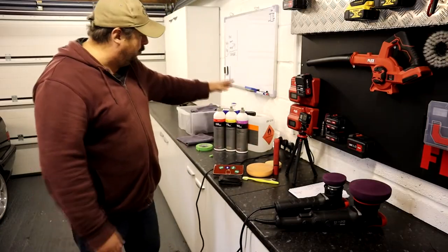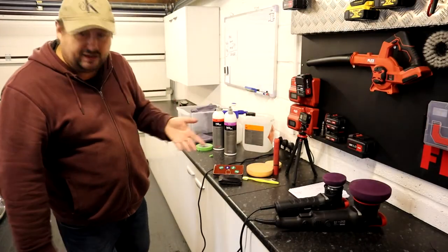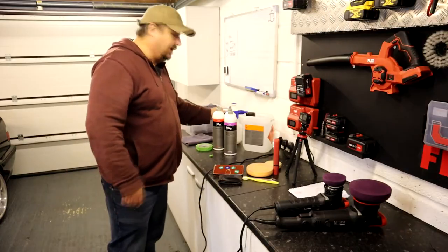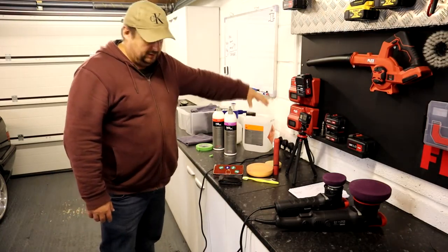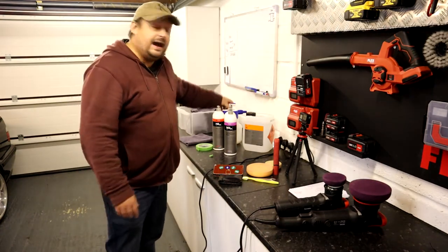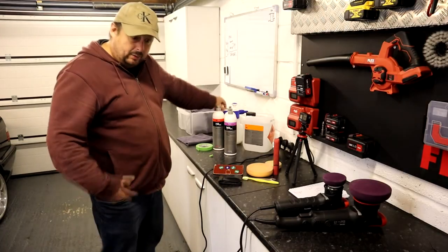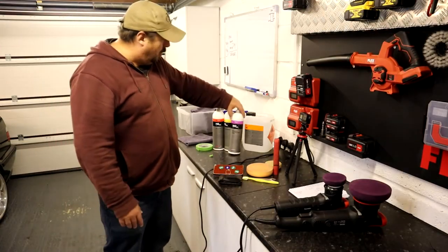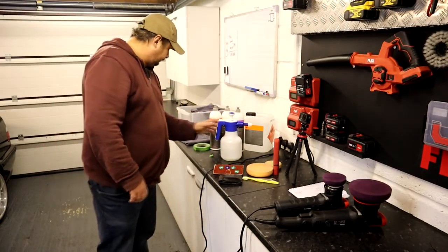I've talked all about panel wipes, guys, before. We're using Koch Chemie, which is a concentrated, think of it as 99% proof IPA. We put in 2% Surfex, so we use about 25% of the Koch Chemie, 2% Surfex HD or any APC, and then the rest, 73%, is water. That will get you a strong panel wipe to help you do inspections. And I've got it in the old Hanford's pump sprayer.